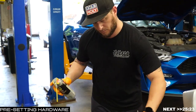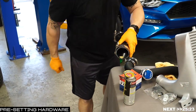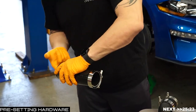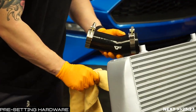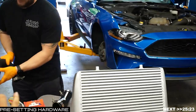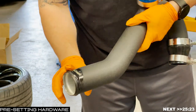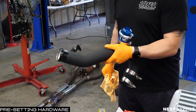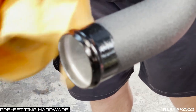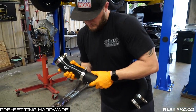One of the reasons we like the CVFAB product is because they put a ridge in their charge pipes that helps keep the charge pipes from sliding past that ridge once you put your clamp on. You want to make sure you're clamping north of those ridges so that the clamp has good bite. The length here is all going to be dependent on once you get it installed — and because we put the WD-40 in, it allows you to slide it both forward and backwards for distance.